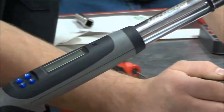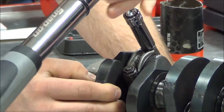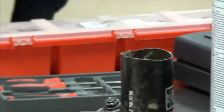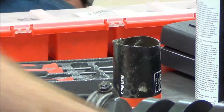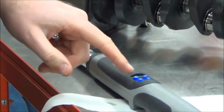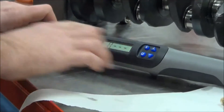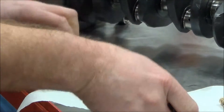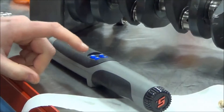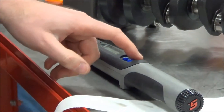I'm only at 6 pounds and I need 20. Now from here I need to change my tool to get into a degree measurement, and I have to set this flat. Right now it's finding a zero — last time it was at 90, I need to reset this flat. There are intentional places on the tool to find this degree of torque. I'm going to toggle through, make it reset itself, and then pump this up to 120 degrees.